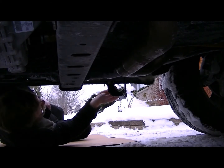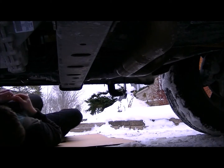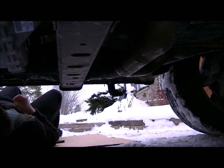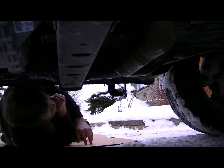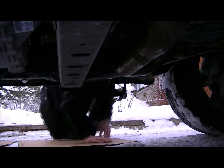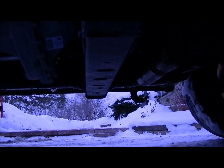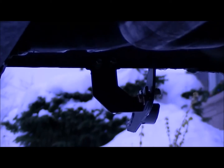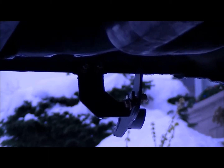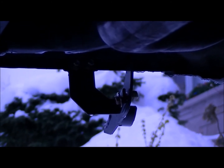This set of side steps comes with a little piece that you can put in from behind that's got a bolt on it that comes out through the hole from the other side, and you just screw some nuts on this side to support it. Lucky for me mine are all threaded already, so I'm just going to get another washer to put on that, and then I'll be able to tighten this one down. Next will be to come down here and do the same thing, and down at the end. There are three spots for these to hang, and they're pretty obvious once you get underneath. So you can see I've got the brackets on there, using the eight millimeter bolt into the body for the main bracket, eight millimeter bolt across for the support bracket.